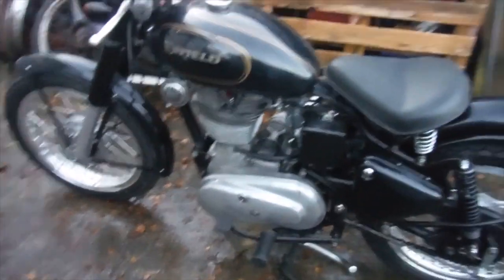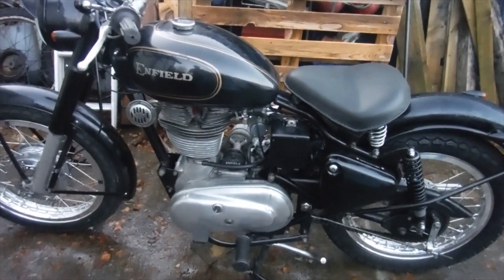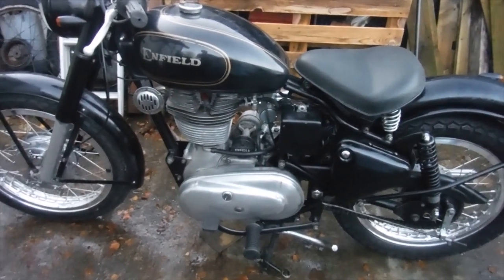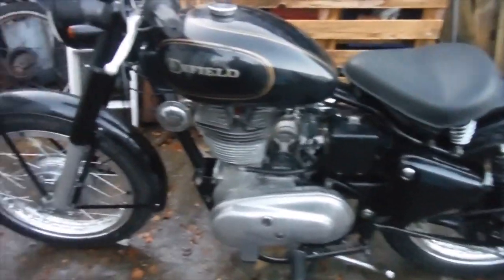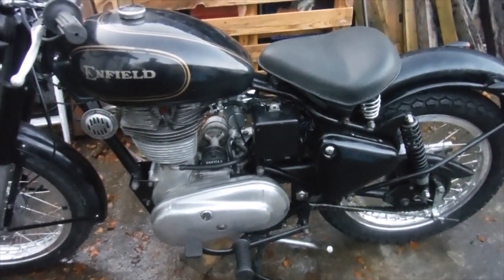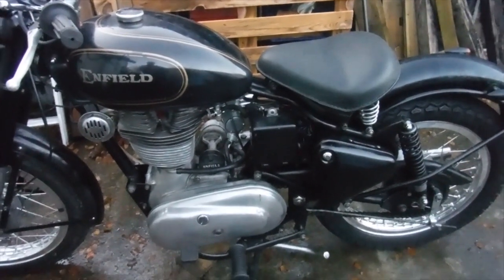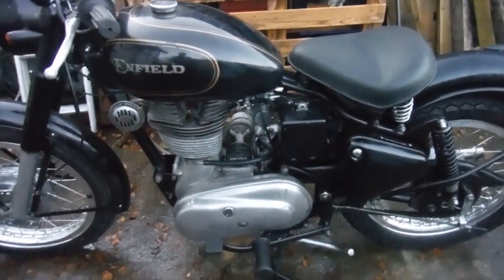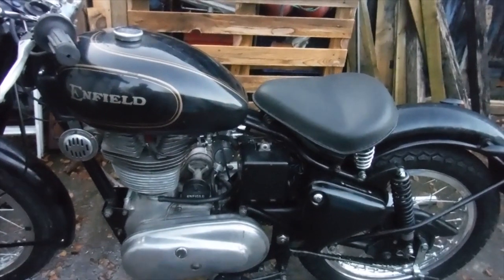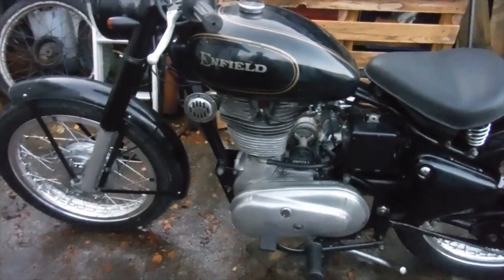Finally, it's taken most of the day to get that thing to run at all. The ignition timing, where the rotor is set against the back plate, just makes no sense at all compared to the instruction sheet and where it was set originally when it came here. I was going to start thinking about changing the entire ignition system if a coil didn't do the trick, but I decided instead to move that rotor round bit by bit, and I'm so glad I did because it saved a lot of work and wastage of useful and working components.